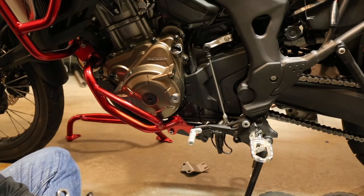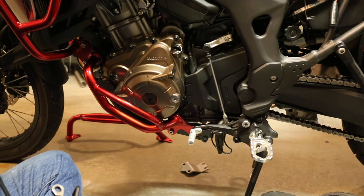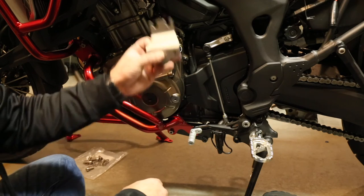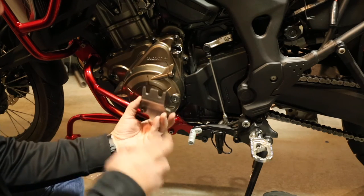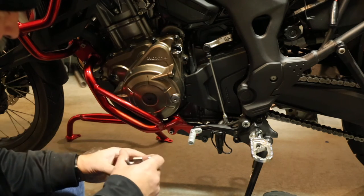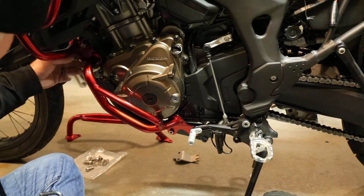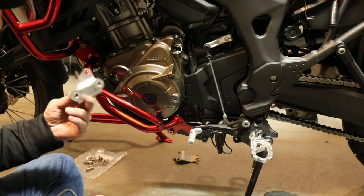Did you hear it click? Take your old bolts out — they gave you two new ones to put in on that side. We're going to go around and put this on the other side. The other side has a little bracket — you'll see a U-shape. There are some bolts over by the muffler, so that bracket goes in over there. I'll see if I can get the camera over there so you can see. These bolts go back in the same bracket. If you haven't put this bracket in yet, you don't need to take the exhaust off.